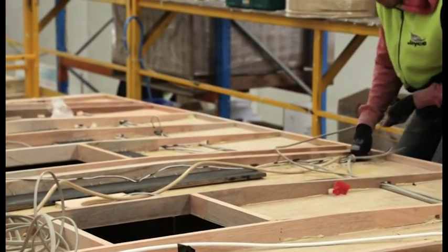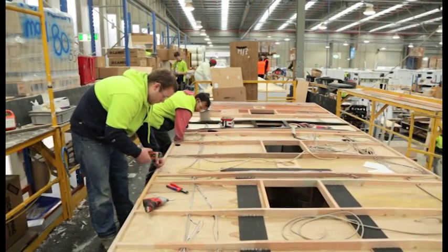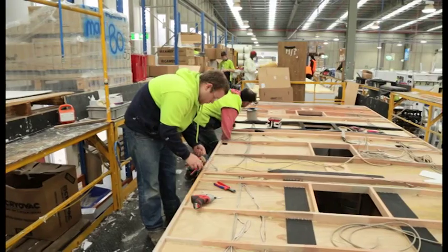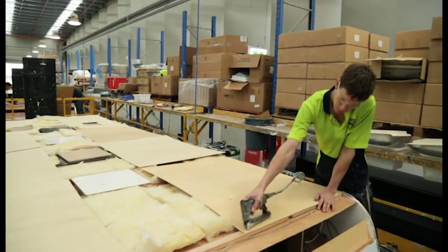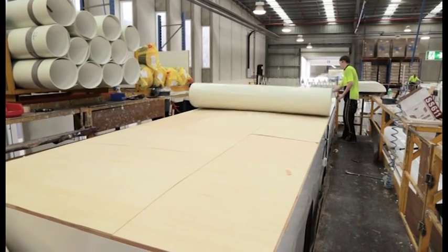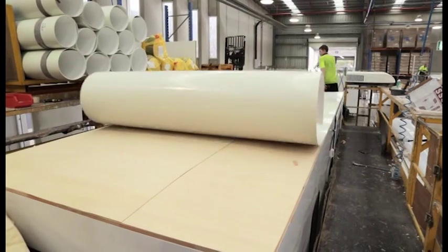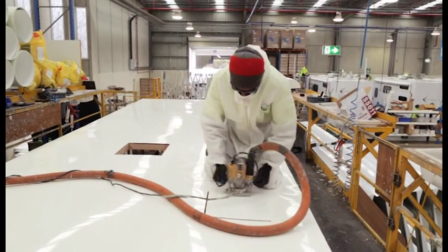This includes lots of electrical wiring for things such as the lights, air conditioner, solar panel and more. Following the wiring, the insulation is laid, followed by another layer of ply which is stapled to the frame. Finally, the one-piece fiberglass laminate skin can be rolled out, and a router is used to cut the apertures for the roof hatches and the air conditioner, which can then be installed.